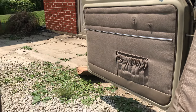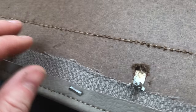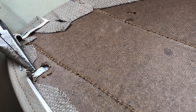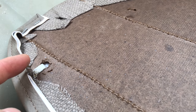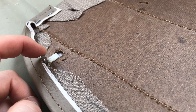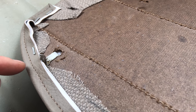I'm in the back of dad's Oval on another hot day. I've got the driver's door card in and I'm putting in the rear ones. A tip: when you use an old door card for a pattern, the clip holes can end up slightly off. But you have a radius to work with, so you can pivot the card quite a bit by just moving it to either side. You can also bend the clip itself in or out to get about a half inch of adjustment without drilling a new hole.